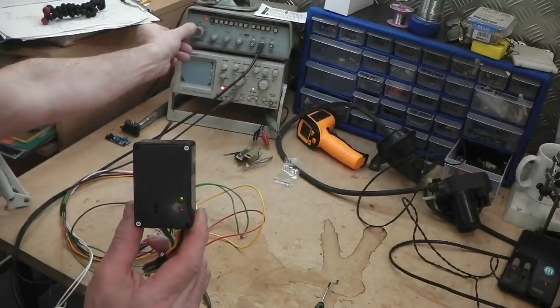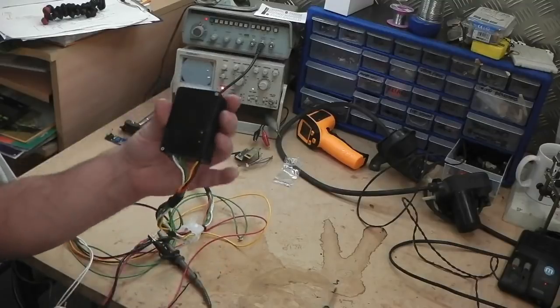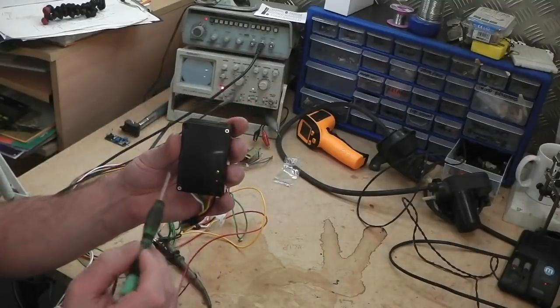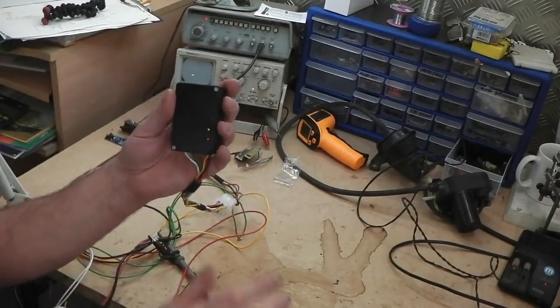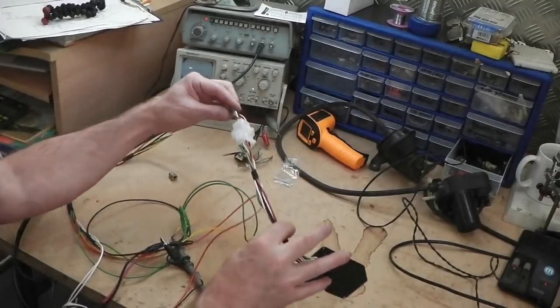and it's out. Now I can adjust that range down to a couple of mile an hour by putting the screwdriver just into this little operating slot here, and there's a little tiny adjuster, and I turn it just to fine tune where I want it to work. So that's going at the moment. Here's all the wires coming out of it on a Molex that I've built.